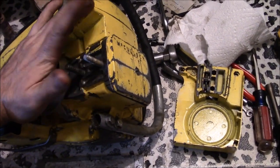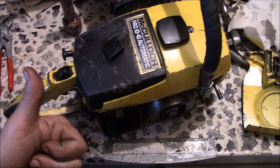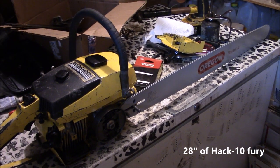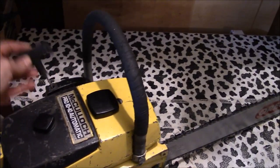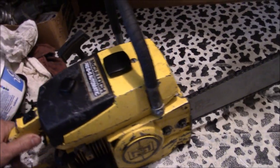We gotta put the bar on there and stuff and the chain. And you know, we should test fire it to see if it runs first, but we're just gonna keep putting parts on it and then find out later. Did check for spark, however, and we've got that. Oh yeah, look at that bar. And there it is. Stole pull cord off an outboard motor, but it'll do for now. And she's ready to go outside and see how much oil it leaks or if it snags a ring.